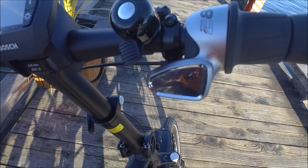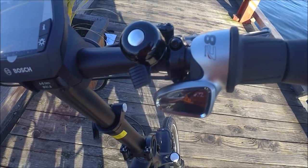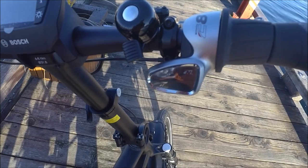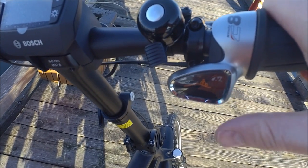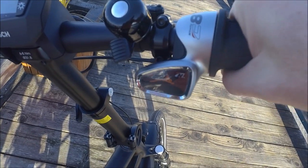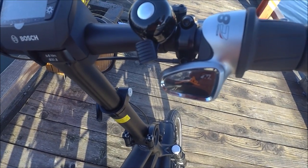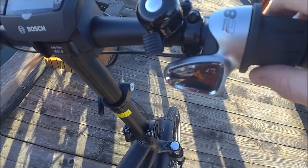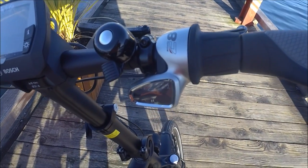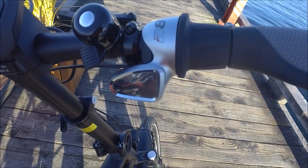If the grade of the hill changes while I'm climbing, I can simply adjust that as I ride. If you've ever been in the wrong gear when you stopped on a regular bike, you'll know how awesome it is to be able to shift while you're stopped. With a regular chain, cassette, and derailleur, if you stop suddenly and you're in a hard gear, you can't use trigger shifters to shift while stopped — it's not going to work, you'll get terrible noise, and it won't shift. With the N380, the NuVinci system allows you to shift while you're stopped. So you don't have to worry about planning ahead or figuring out the ideal gear for a hill — you just go ahead and ride and make adjustments as you need to. I love how easy it is to use; almost all of our customers that come and try it just fall in love with it.